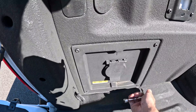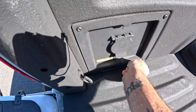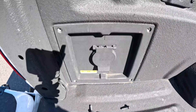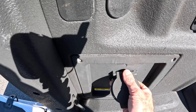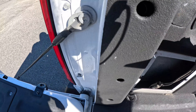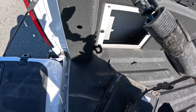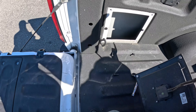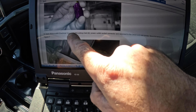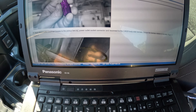Just four of them — I'm at the house so I don't have my Milwaukee. Let me get these all done and then we'll pull it out. Got all the screws out. It's probably stuck in there — we've got Rhino lining. And I'm going to show you guys something. See what it says right there: apply Motorcraft electrical grease to the pickup bed AC power outlet socket connector and reconnect it. So we're going to put some dielectric grease on the new connector.